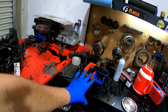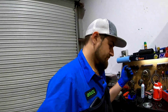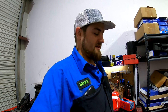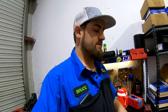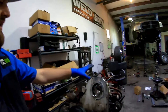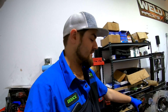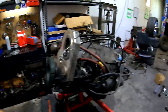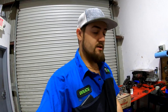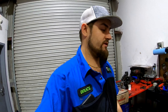I'm gonna move on to getting this engine 100% torn down — get the billet covers off, get them cleaned up, get all the billet freeze plugs out, and get this thing completely stripped. I'll leave the crank in there. I actually don't need to pull the cam out because I've got a new cam going in. I've also got another P-pump timing case laying around, so I'll just leave the current one together and use the other timing case. I want to avoid pulling the oil pan too since I've got another one, so I'm trying to avoid making a huge oil mess.